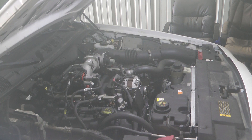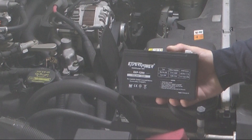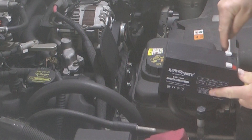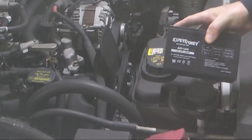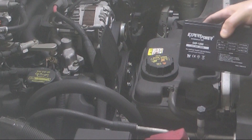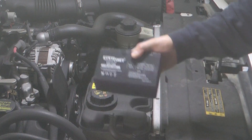For our power source, I picked up one of these 12-volt, 9-amp-hour batteries. If I find it's not enough to power the vehicle very far, I did get a second one. There are a couple ways you can wire these: you can run the ground to the hot of the next battery, then have the ground and the hot go to the vehicle — that'll double you to 24 volts. Or you can have hot to hot, ground to ground, go to the vehicle, and then you'll have 18 amp-hours of 12 volts — same power but twice as long, or twice the power for the same length of time. Either way, it's going to work great.